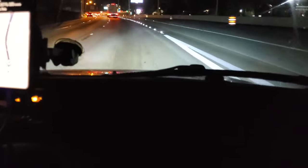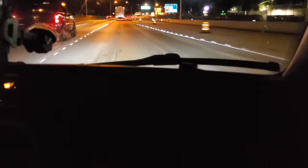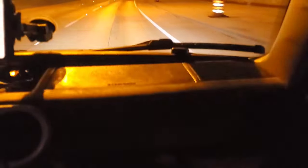It goes away for a while, but then when you go straight again, it makes this grinding noise. We think it's the right bearing, and we know because we stopped. If you drive for a while, then you can touch each wheel, the front left and right. This one was a lot hotter, pretty much boiling. It's real hot. So we will try to replace it and see if this actually solves the issue.